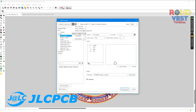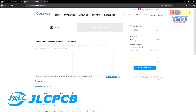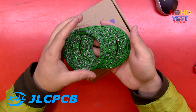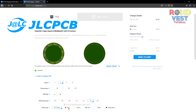In this video you will see how you can export the PCB schematic from Eagle in gerber format, how to upload the zip archive which contains the gerber files on JLCPCB.com, and how to place an order. The production itself as well as shipping time take about 7 days according to the color of the PCB and type of shipping method you've chosen.